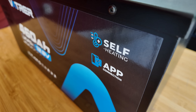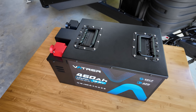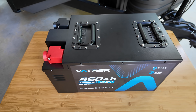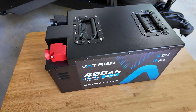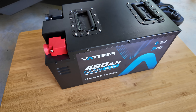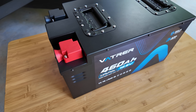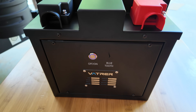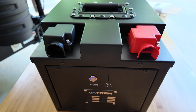It does have an integrated heating pad in the unit. If you keep your battery in the RV in the wintertime and the temperature drops below 32 degrees, it will activate and heat up the battery, then cut off at about 41 degrees Fahrenheit. Like just about all lithium batteries on the market today, it does have a built-in BMS for safety.